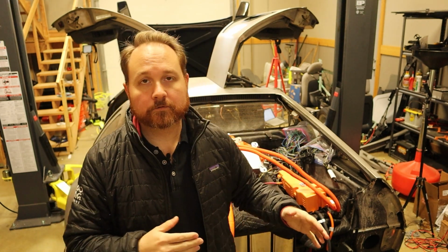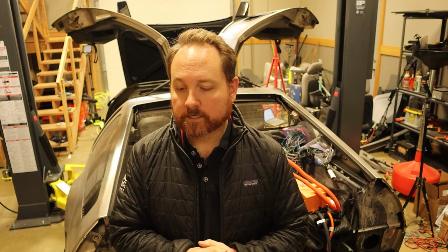All right, it's now been another couple days since the last little video segment I did, and really I'm just doing this to express my utter frustration at how things are going right now. I've basically spent the last 2 or 3 days since that last video and since the live stream really trying to get the car motor to spin, and it hasn't happened yet. The reason is that I haven't been able to get the high voltage contactors to click closed to give high voltage to the rest of the car.